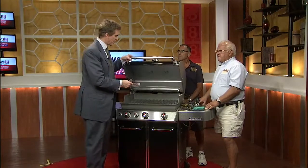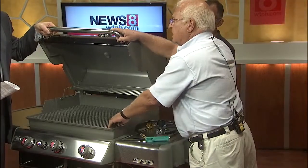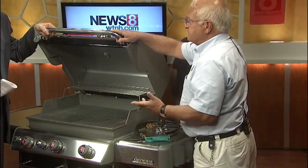Any of the vendors selling gas grills have a technician available to resolve those issues. These are common parts that you can buy at most stores that sell gas grills. What about cleaning the grill — how much does it help ensure a long life? It helps. If you don't clean it, you can get fat buildup on the bottom, and that'll ignite, giving you a big fire inside the grill. Most of the better grills today are all stainless — this is probably going to last longer than we are. When you're done cooking, let the grill run for about 15 minutes, then shut it down. All the residue will be carbonized into almost a powder and brushes off very easily.